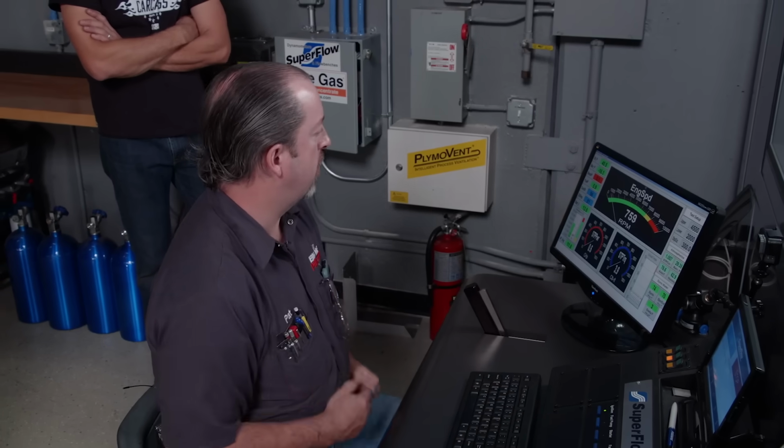All right, so we are back to race ready here, if there is such a thing. Okay, here's the deal. We initially thought this engine was a 232, right? Because that's what it said on the fender. Right. The problem with that is it only made like 100 horse and like 180-something pound-feet of torque, very low 180. But it's actually a 258.